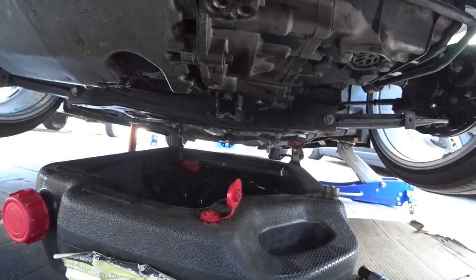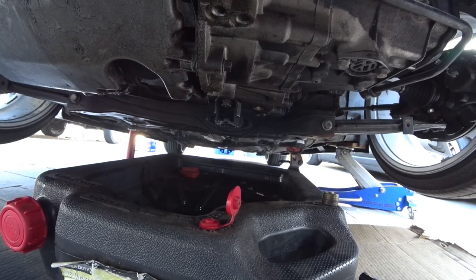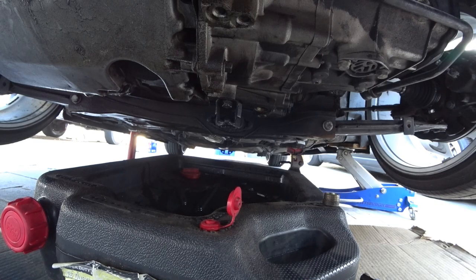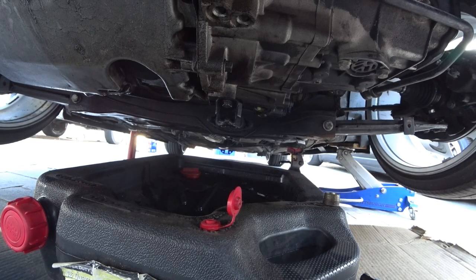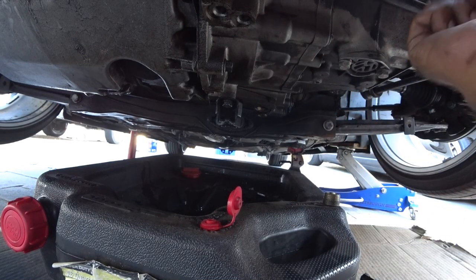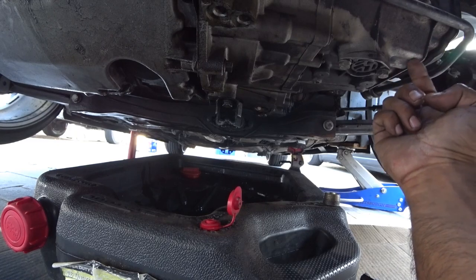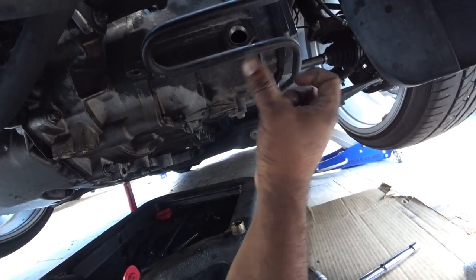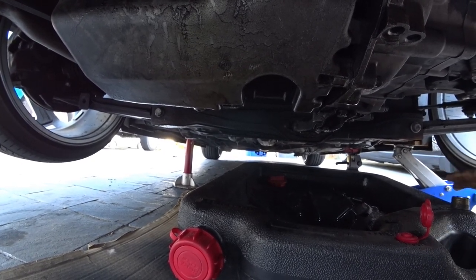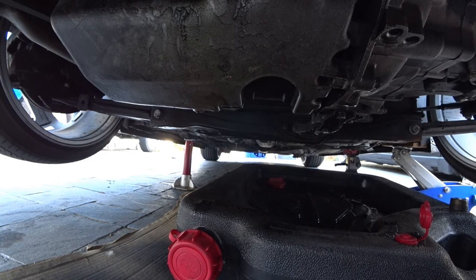Now our transmission is starting to drip. The transmission uses three quarts of fluid — or what I say is two to fill. You put two in and then you start dumping the third one in, and eventually it'll start spilling out — that's when you stop. That's just usually what I say: two and then the third to top off. Once it starts spewing out of the fill port on top, you're full. You can't go any more than that. Usually you want to do this in a more level area; I'm kind of jacked up pretty high, so I'm hoping all the fluid will be coming out.